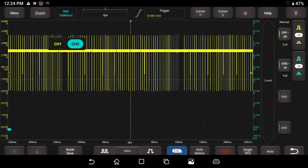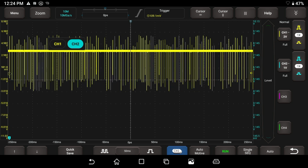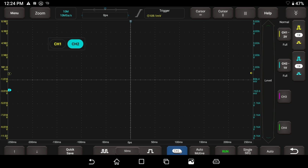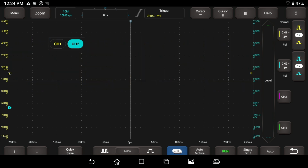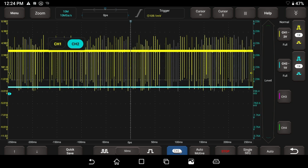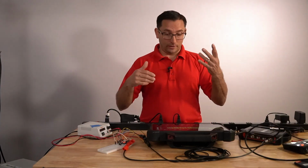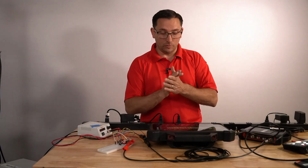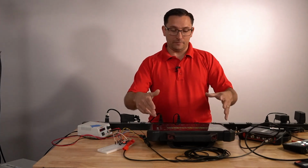And I don't know where my channel 2 is. Let's hit the record button. I didn't have it on. So we should have channel 2 coming in here. There's our channel 2. I can move this up and down. You see, that's what's going on. So you select which channel you want to move by this menu down here, channel 1, channel 2. It's very important to understand that, because if you don't, you'll be lost like I was, and I was monkeying around trying to figure out how to use it. So that is the basics about the trigger and some of the navigation here.